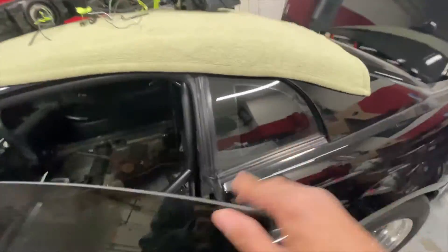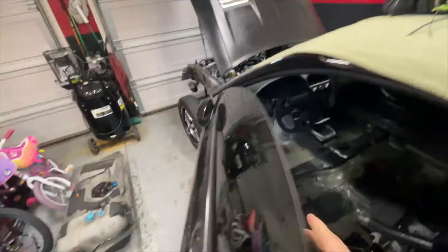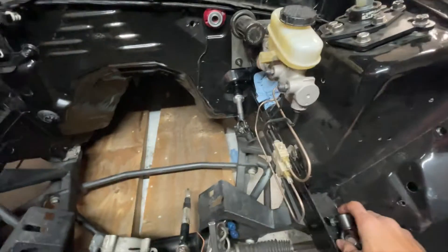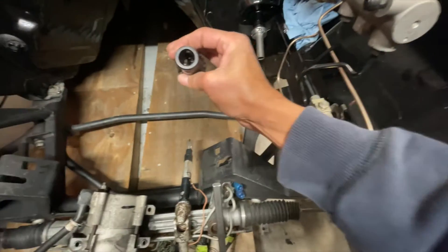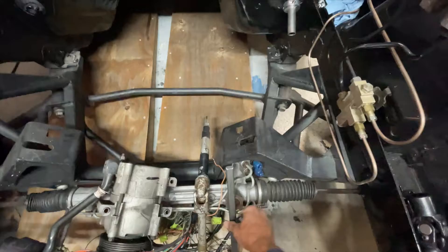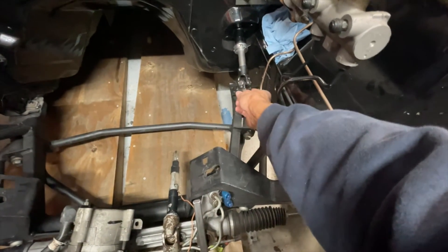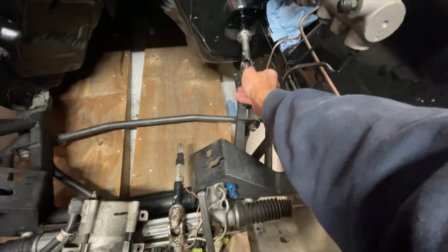The steering shaft is in. I did have to go back and tighten down those two nuts to the firewall just to stop the entire column assembly from moving while I played around with installing it. I realized you only need two U-joints, not three. You need the one that goes straight to the steering column's inner shaft — the circular one for the solid shaft. Once you get it mounted, you'll have to drill a hole through the inner shaft. It actually has a stop in there so you can't over-penetrate, which also prevents play from the U-joint.